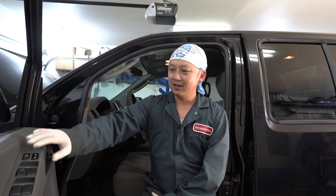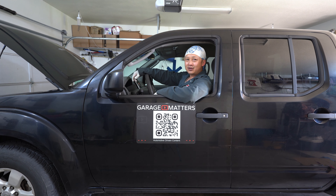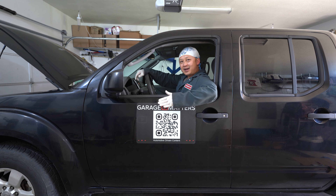After cleaning this control panel, all the windows work again and it should be fine for a couple more years. There is another option which is to replace the whole control panel — my guess is it's probably around 100 bucks. Cleaning these window switches is not specific to this Nissan Frontier; it's going to be a very similar process for most makes and models. Hopefully this video helped you get your windows rolling down and back up — that's going to do it this week for Garage Matters, and remember to hit that like and subscribe button.